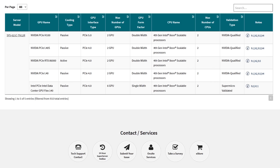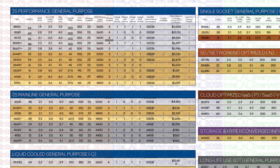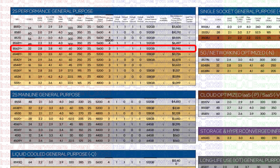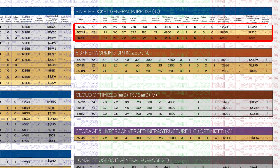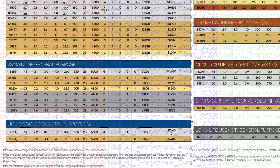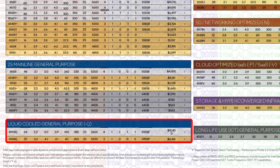Intel's full price table for the Emerald Rapids launch shows the CPUs I have squarely at the bottom of the first group — top-tier CPUs, but only 32 cores, and still some of the highest-turboing CPUs this generation. Also notice the memory speed: DDR5-5600 officially supported, which is pretty huge for DDR5 compatibility. Intel is also offering three SKUs in single-socket configuration, plus liquid-cooled CPUs up to 385-watt TDP.